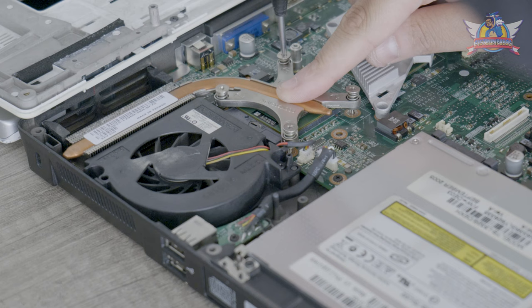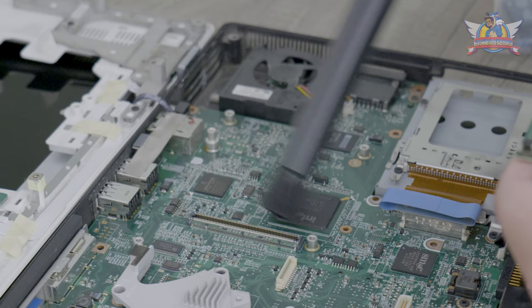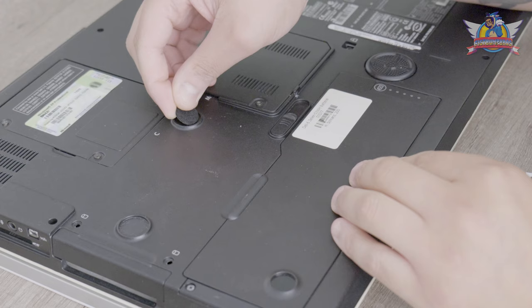Time to install new paste for the CPU and place back the copper heatsink guide. The discrete GPU is up next — I remove the GPU assembly and the copper guide, as was the vapor chamber, have dust all around them. I clean up the dust underneath the GPU then place it back. Now it's time to get to the GPU core itself. I remove the top plate to reveal the GPU chip, clean it with a special cloth, and apply new thermal paste before closing it all up.